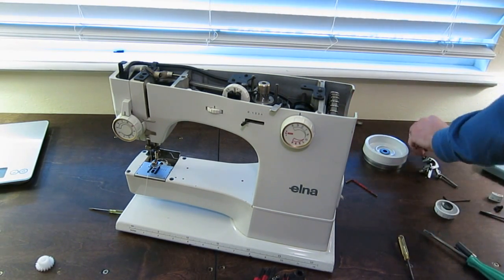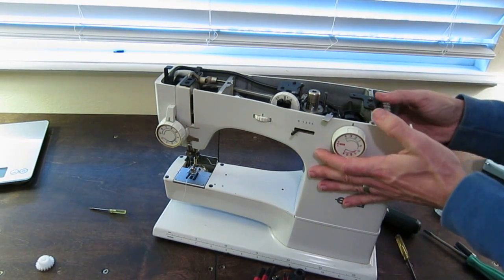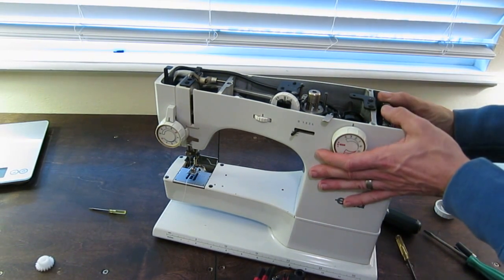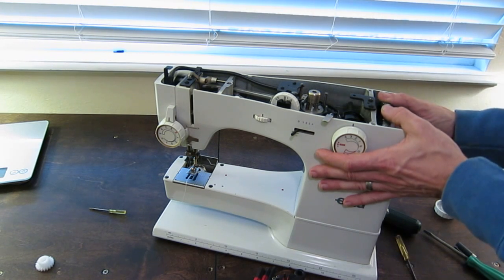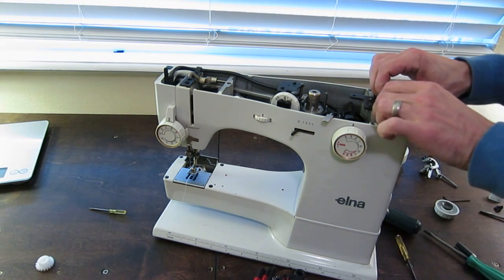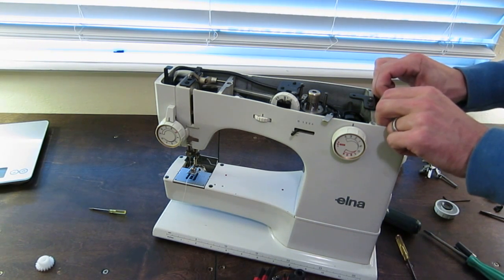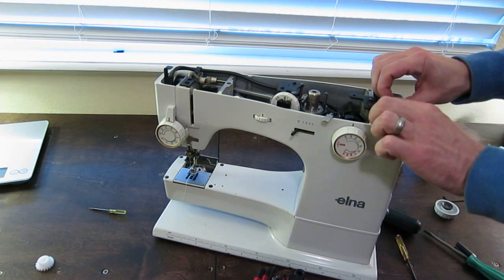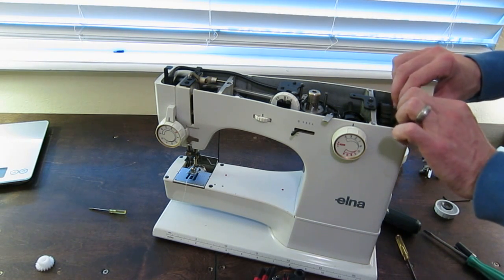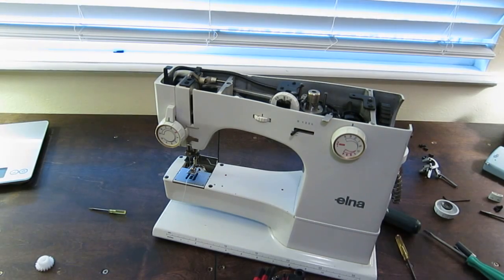And then 4. Okay, now you're going to very carefully, I'm going to rotate this around so these are all lined back up again. Okay, you're going to slip this off. You're going to slip your belt off very carefully. Okay, kind of put a little upward tension on it and just lay it down on the side. Okay, just let it hang over on the side there.